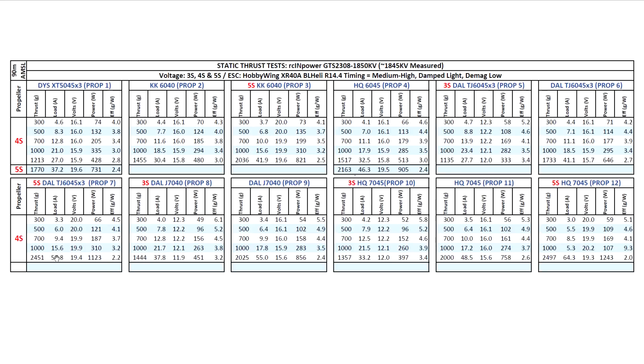Keep in mind that this is static thrust, so in dynamic conditions as the propeller unloads, these numbers are going to be quite a lot more manageable — it could be up to 35 or even 40% lower. Moving on to the 7-inch props, still on 3S you get pretty decent usable thrust at very low amps. On 4S, 2 kilograms. The 7-inch HQ prop run on all three voltages — 3S, 4S, and 5S — climbs roughly 500 grams for every additional cell: 1400, 2000, and almost 2.5 kilograms. Pretty capable motor.